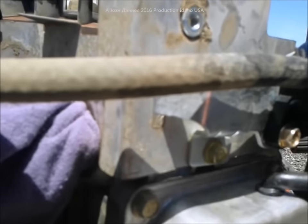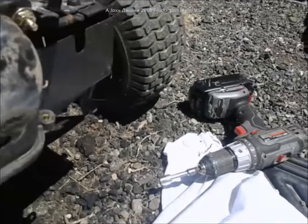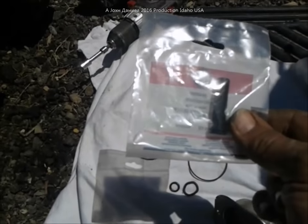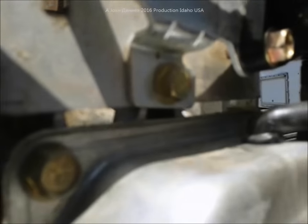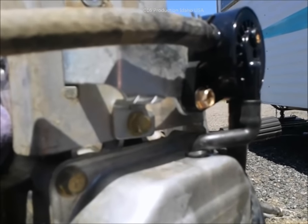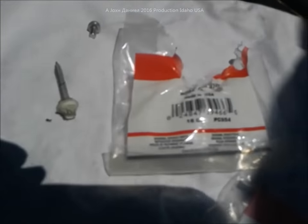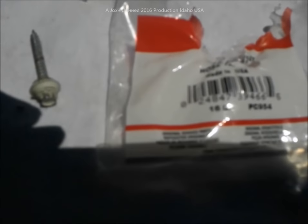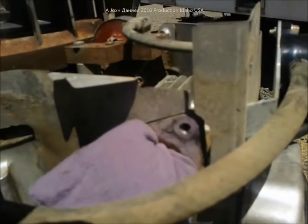There's usually a lot of debris or backflow from this line when you take it loose and it will jam up your fuel pump in my experience, so I would replace that fuel pump right there. Now when you do a search, it tells you that this is your vacuum line for most all of your Briggs & Strattons. I ordered a pair of them — this one, which is that right-angled or offset vacuum line, and this one just in case the vacuum line was just bent. However, the offset one fits the 22 Intek and this other one fits the 25 horsepower. The difference is where the fuel pump is located.